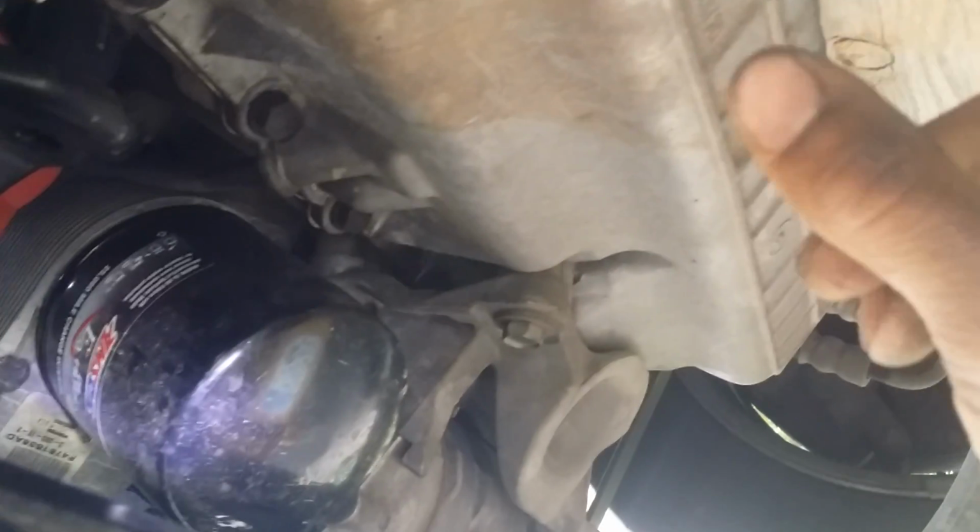Now, what I'm going to do is put the bolts back in and secure it to the motor. Then I'm going to drop this bolt back into this hole. And then I'm going to slowly let pressure off the motor and let it drop down a little bit until it drops into the hole. And then I'm going to go back up there and secure the side motor mount that we loosened to take pressure off. And I'm going to secure the back so everything's safe.